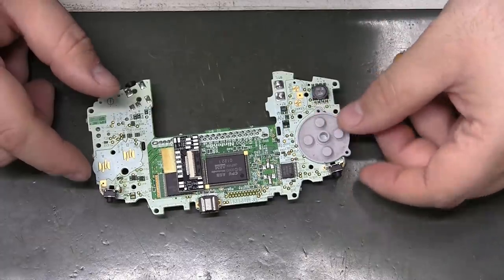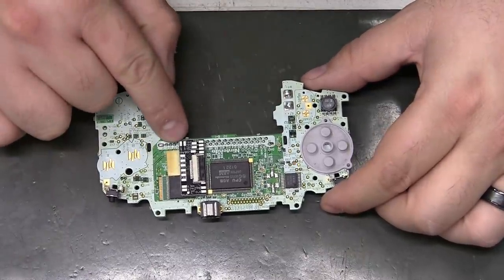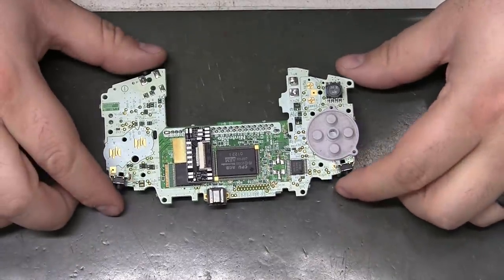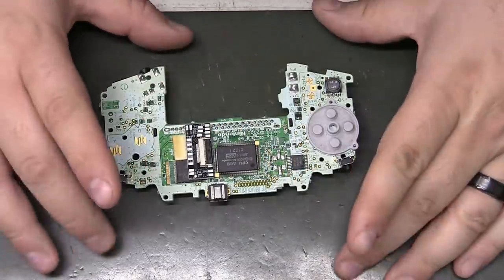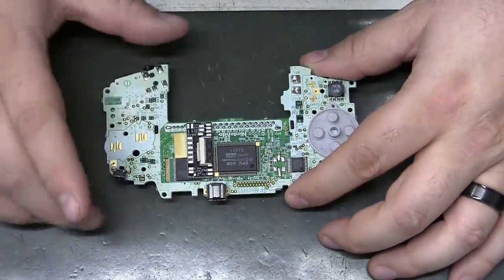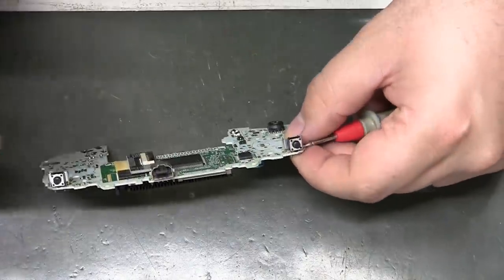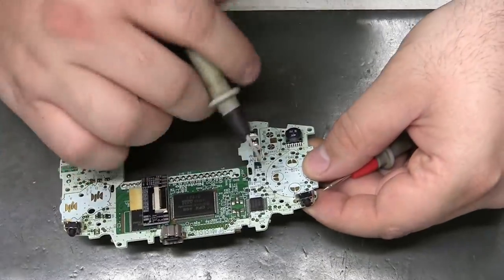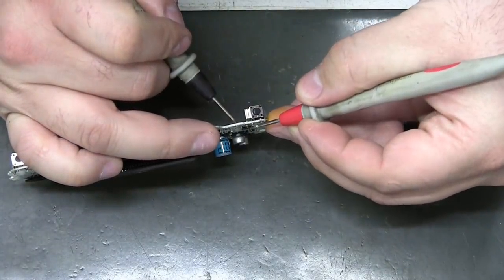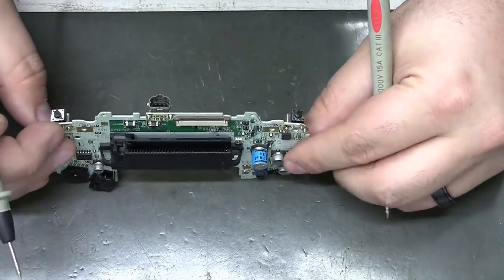I always like trying to get the easiest solder spot that I can. So, like, we're doing the battery terminals, C2. If we go back to the other side for the switches' pins, and then the one for the oscillator, those are stupidly easy, but the rest of them are these really tiny little test points. I mean, it's even labeled TP, which means test point. Not as easy to get a hold of. Well, I just toned it out, and I believe it's TP9 that we're going for. Left switch is on the inside, so it's the same pin. It just happens to be that pin on the right. It's not the outside pins.